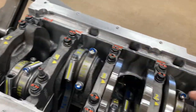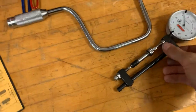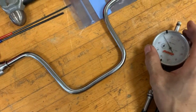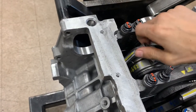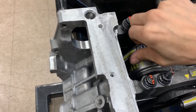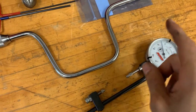What I did to save time is mix-match and pair the two closest bolts together so the dial doesn't move drastically between them. You zero the first bolt, take it back out, thread it in by hand down to the seat, then bring the second bolt out and verify it's at zero or extremely close before inserting it into the other side of the rod.